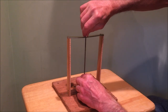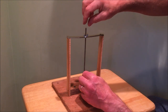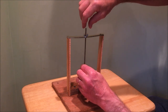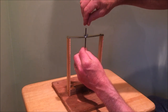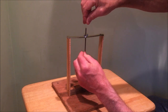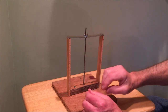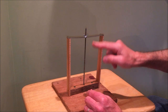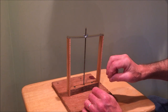The secret and top tip for working with bladed spokes is to turn the nipple and the spoke together at exactly the same rate. You hold the nipple with the nipple holder at the top of the rim, hold the spoke with the bladed spoke holder, and turn both tools very carefully together so the spoke and nipple turn the same amount until the spoke is oriented aerodynamically again. That's how you fix the spokes without changing tension or knocking the wheel out of true.